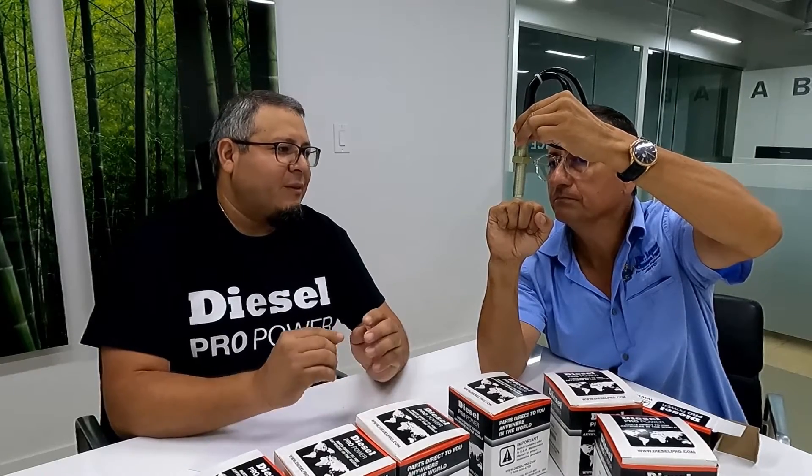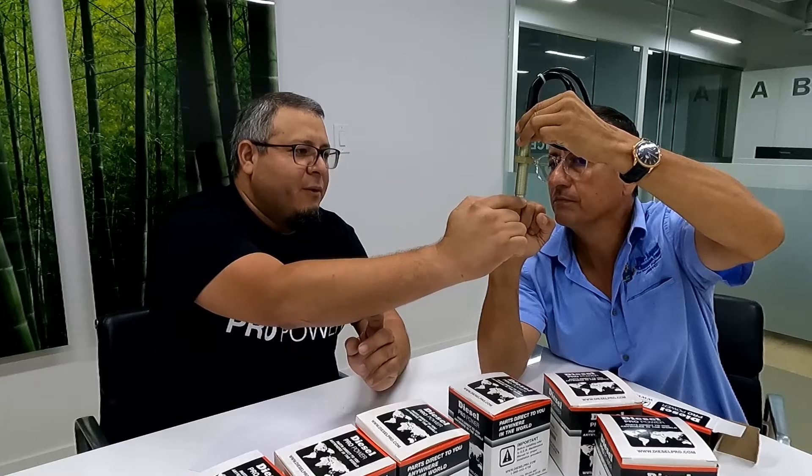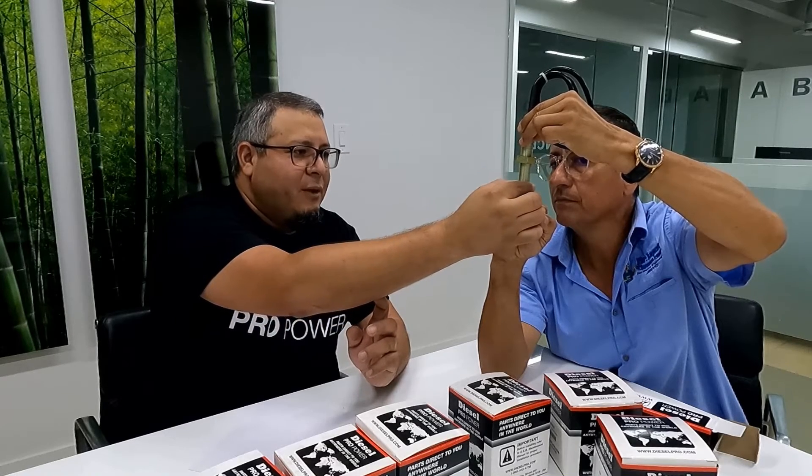I saw a lot of generators where this sensor is installed in the bell housing. The flywheel's main function — what it does is read the space between each tooth of the flywheel. The magnetic pickup reads the metal between each tooth, and that gives the sense of one tooth. So as I mentioned, if it's 113 or 114 teeth, every time the magnetic pickup sends a signal for 114 pulses to the tachometer, that will mean one RPM. That's how we reach the amount of RPMs on the engine.